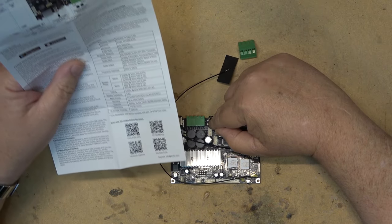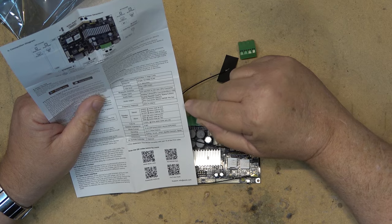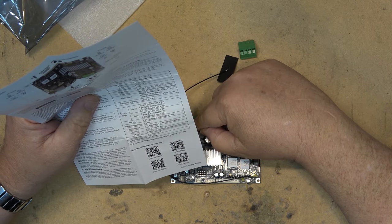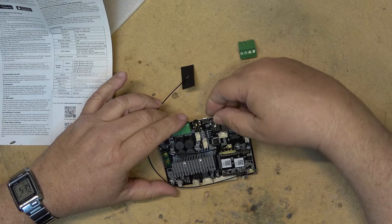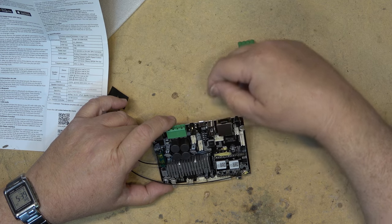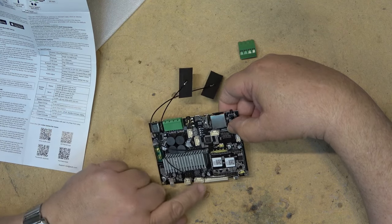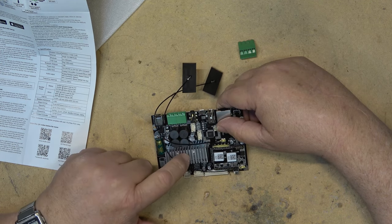There's the power plug right there. Audio output is here, and there's also an analog input — a 3.5 millimeter jack, which is an input not an output. There's an analog output, a speaker output for your speakers, a four-pin connector, a two-pin connector, and S/PDIF. There's a four-pin connector for audio out, auxiliary 2, phono in, and a digital output. The DAC output is over here — that's probably your audio out.